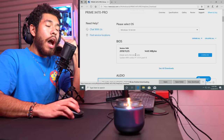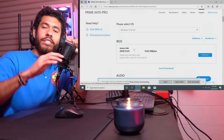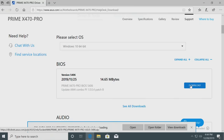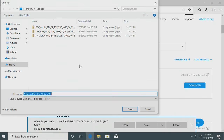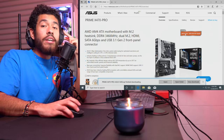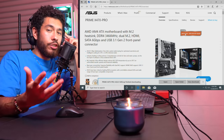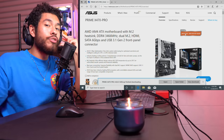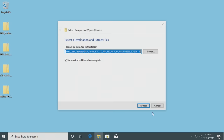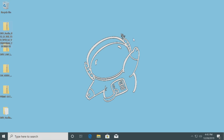Download the chipset driver if you wish. Up here I'm going to be downloading the latest version of the BIOS. Updating the BIOS is not required but it may improve system stability. All drivers are zipped - we need to unzip them. Right click, extract all, and it automatically opens up the new folder. We can now install, and we'll do the same thing for all the rest.